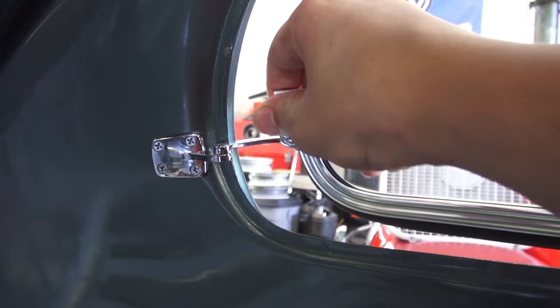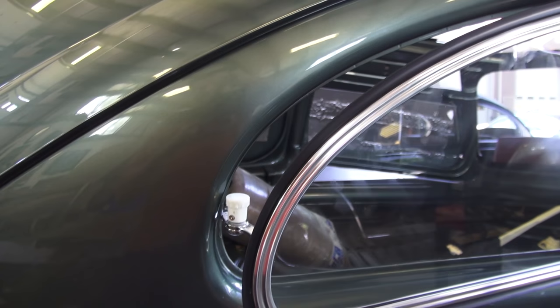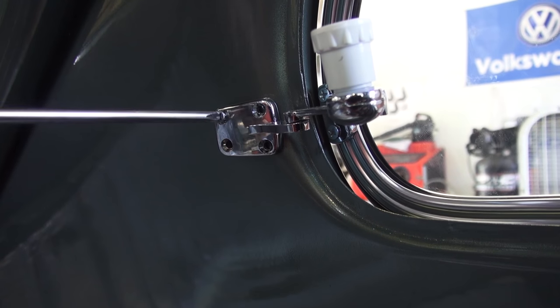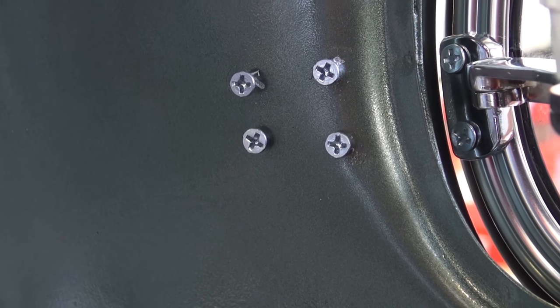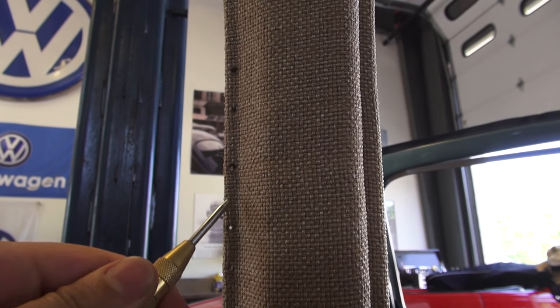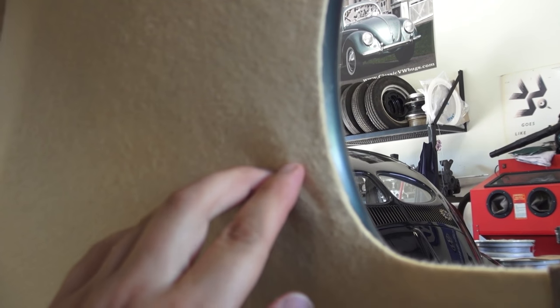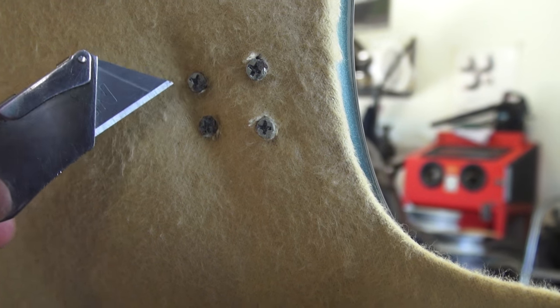Turn the knob to tighten the latch and the window opens. Come outside and take a good look — everything looks good. Now take the window out because you need to put your headliner in; this was just a test fitment. If you already have the holes pre-drilled, just put the screws in place so you can feel them later once the headliner is in. Now that we have the headliner in place on the door post, I can find the holes with my punch. For '63 and later beetles the holes are already there. For the back area covered by the headliner, I cut very small slits to expose the screws.